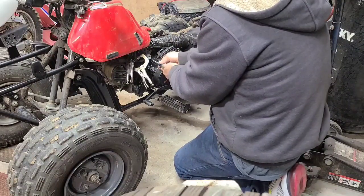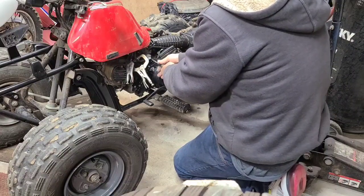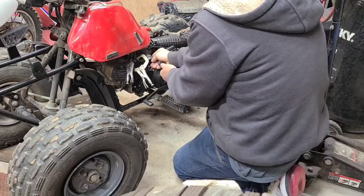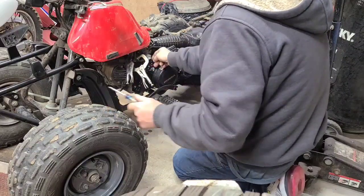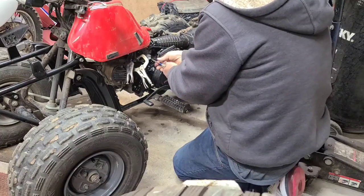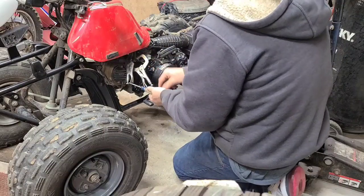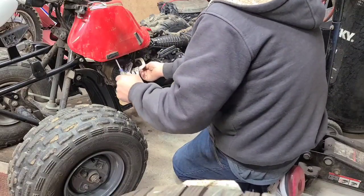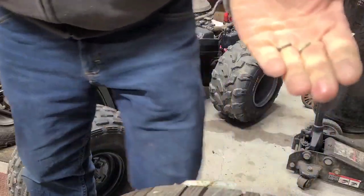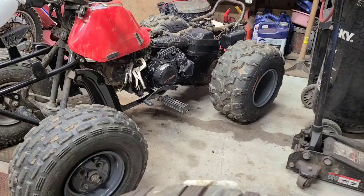I think I might just post a video on this one, but you see, I rebuilt the carburetor on this, and the seat's so bad, it won't stop leaking. And the seat's not changeable on this one. That's what I'm saying, if you remove these two screws, you can shut the petcock off and just leave it there.